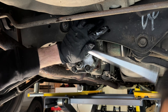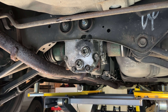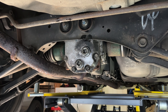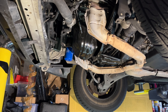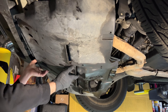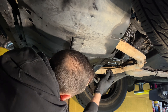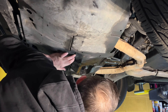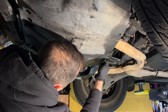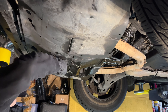Torque these bad boys down and that's basically how you do a full lube job — just pop a bunch of drain plugs, find some torque specs, use the sockets that fit. This is a great intro for building your confidence on working on a car at home. If you get a used car, this is a really fun project. Might take a little longer than it took me because of the lift, but really like 15 extra minutes jacking up and down is not a big deal.